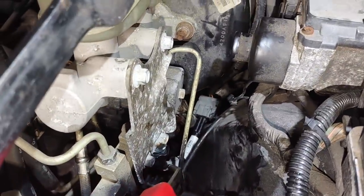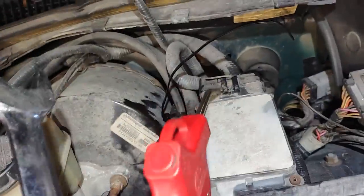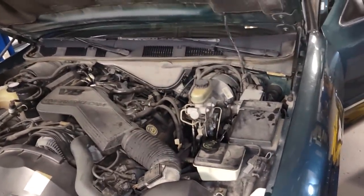XG12 the connector going into the switch, and then XG12 the speed controller. XG12 is an electrical grease, for those of you wondering. That's it — the recall is done. Thanks guys.